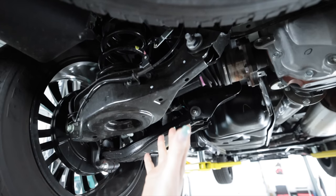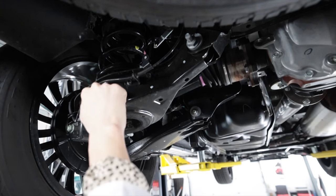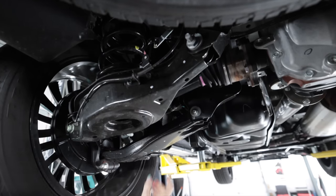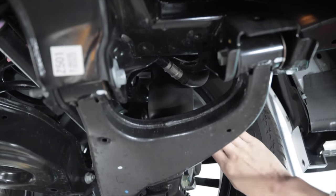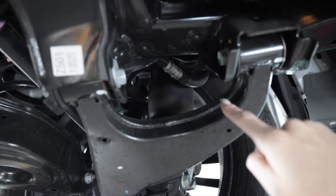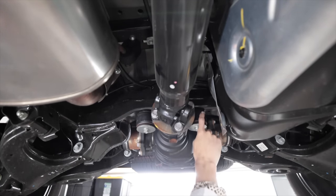Above and beyond, the QX80 utilizes a double wishbone rear suspension — no solid axle back here, but it does make for a more comfortable on-road ride. It has the R246 differential which has a brake-actuated LSD and a 2.94 final drive ratio. All the suspension components back here are painted steel, nothing aluminum, but super durable stuff — really rugged components. If you look right through this rear wishbone, you can see it does have an air bladder right here because this has an auto-leveling rear suspension. This rear diff is pretty stout — you can see it bolts up to the subframe.